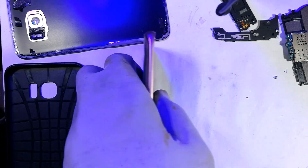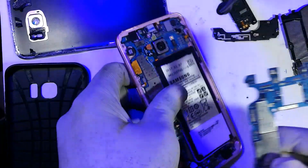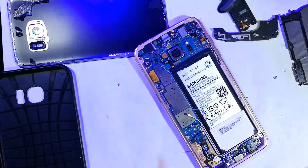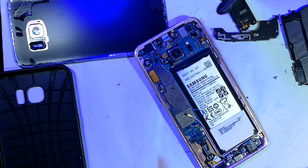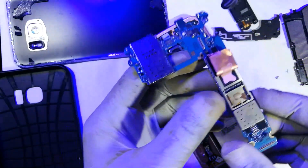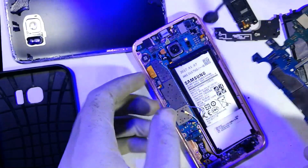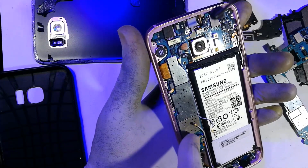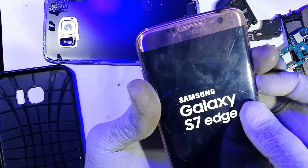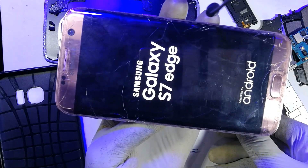It turns out I went off camera and I swapped out the motherboard. It turns out this phone's white blackout is because the motherboard was dead. This is the motherboard that was inside — I opened it up and noticed some stuff had poured in from a fire, so I wiped it, brought it here, and noticed this part was reflowed. I attempted reflowing but couldn't resurrect it. I've now put in another motherboard — this is from an S7 that I had which loses network — and the phone actually lights up and turns on with the new motherboard.